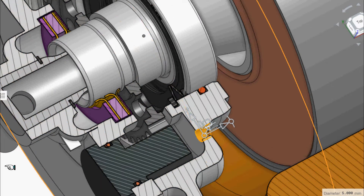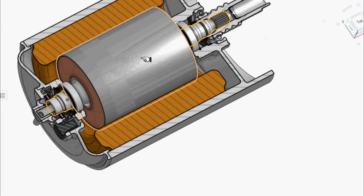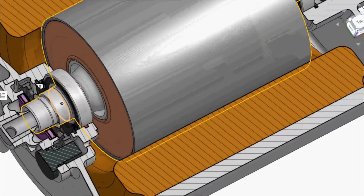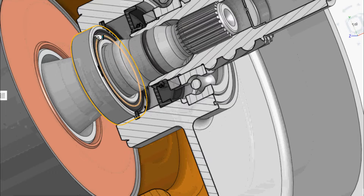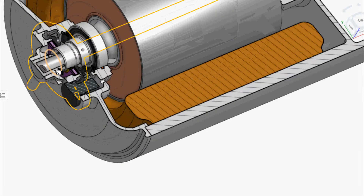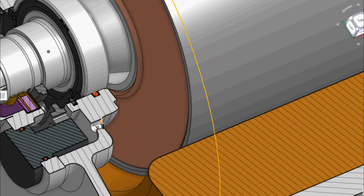But again, there can be consequences. There is a reason why this hole is here. Thermal expansion and contraction of the rotor cause the rotor, plus its bearing, to move deeper into the reluctor wheel chamber. This is because the bearing is floating and can move with this spring over here. The bearing on the gearbox side is a locating bearing — it does not have a spring and cannot move with thermal expansion. For this reason, this chamber over here is not vented. Thermal expansion and air heating can result in pressure differences between the motor chamber and the reluctor wheel chamber, and these pressure differences are equalized through this hole.